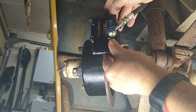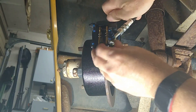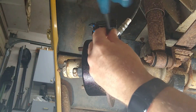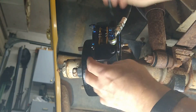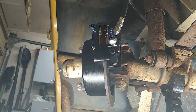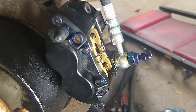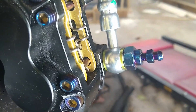I found a four-piston motorcycle caliper designed for pretty much the same diameter rotor as the city car has. The motorcycle caliper just bolts to this adapter block and now it can float as the pads wear. This is the assembled state. I found an AC Delco hose that goes from the metric banjo connector on the caliper right into the bulkhead on the frame, and then the existing brake line from the city car just screws right into the end of it.